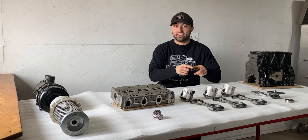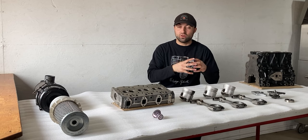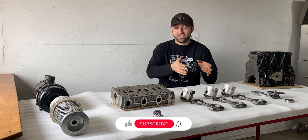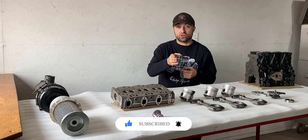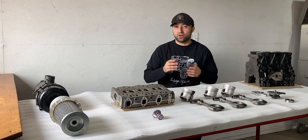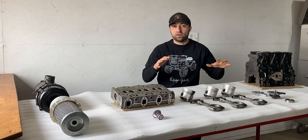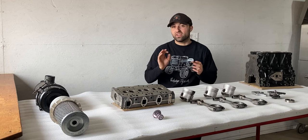In the middle piston there was a little damage on the face, but the piston skirt — which actually rides on the cylinder walls — looks very healthy throughout the whole engine. The oil pump, cylinders, and head are somewhat good. Now I'll move on to the cooling system, specifically the thermostat, the radiator, and the air intake side of things. The engine block is where we have the most damage throughout the whole engine, and it might just be because of too much heat.